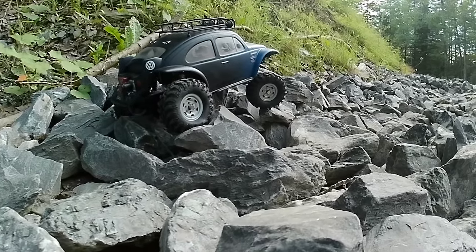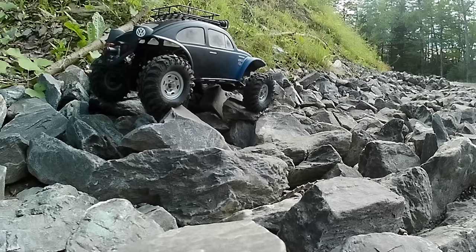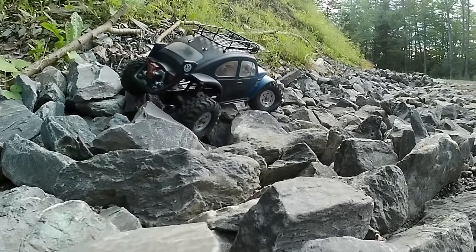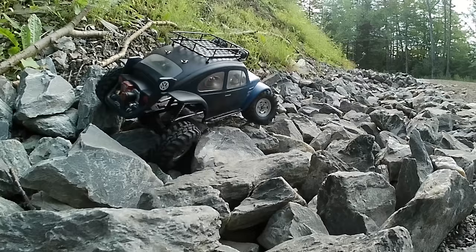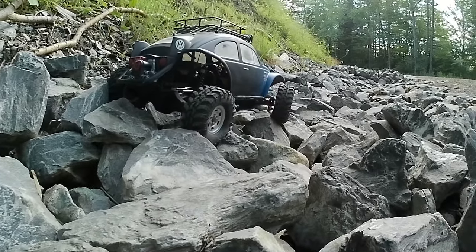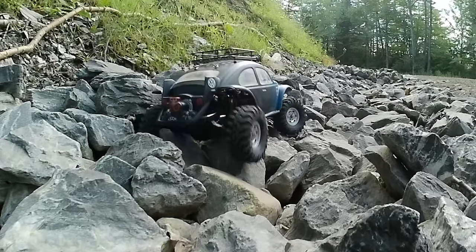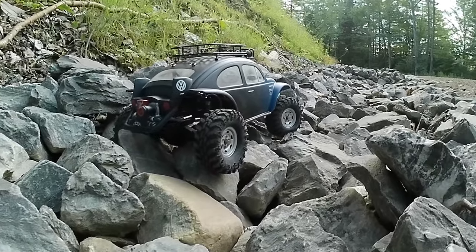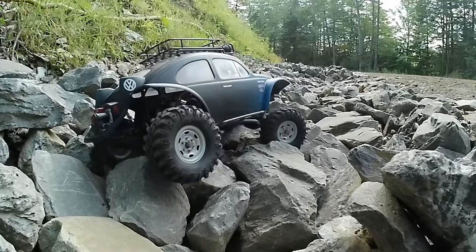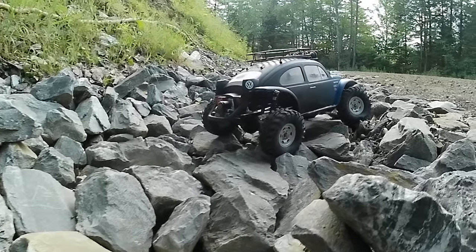I was just a total idiot right when I first got it. It was geared much taller — it had like a 17 or 21 tooth pinion paired with the 88 tooth spur gear, which meant that with the 550 motor in it, the thing was pretty fast. With the original tires, it would do donuts and all kinds of stuff. I was running through mud right away, and it's fairly exposed inside — you've got an exposed spur and pinion setup.